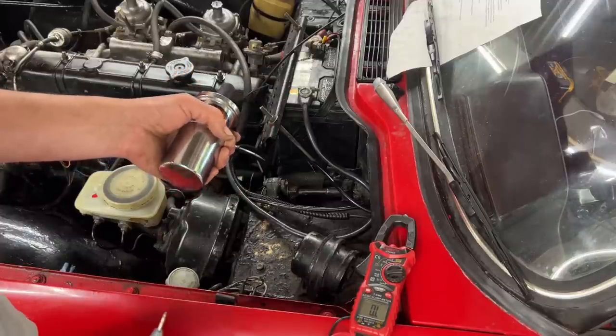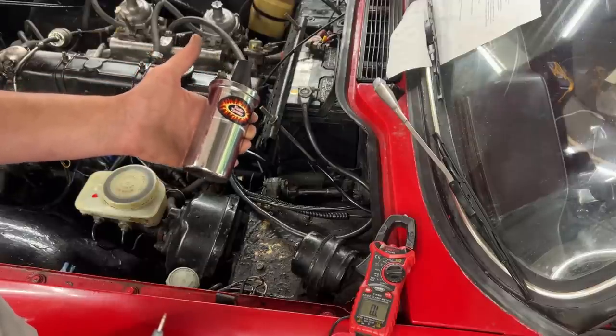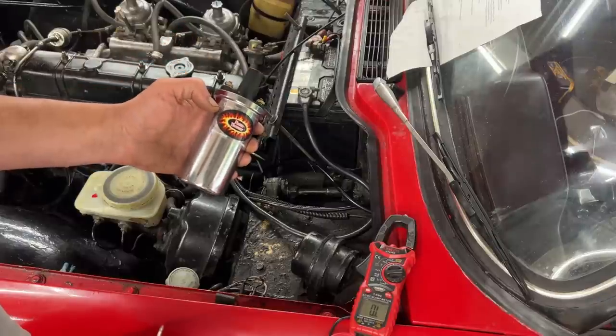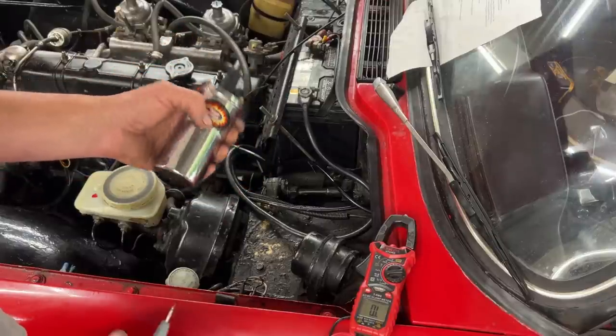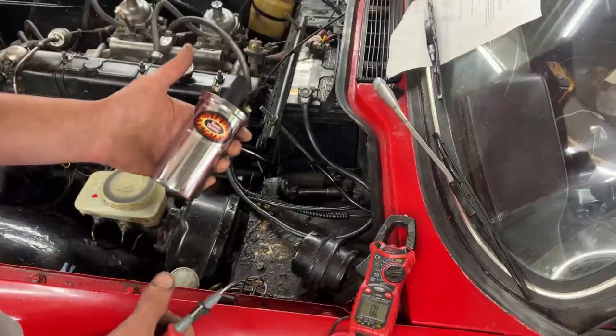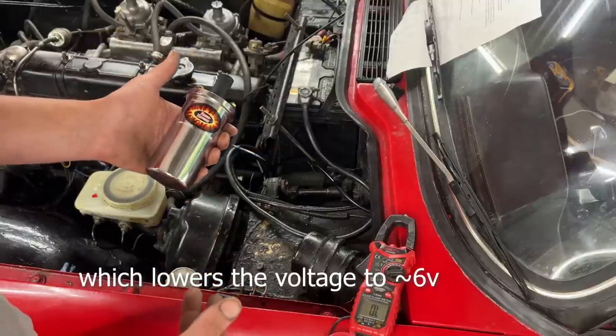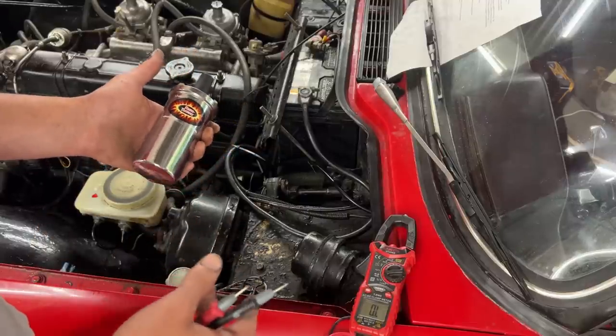So for the old cars, we have a 3-ohm coil, which is perfect for a 12-volt system. For later cars, they started using a 1.5 ohm coil, which runs through a resistor wire, which adds the missing 1.5 ohm. So it's basically again 3 ohm between the coil and the resistor wire, and that's how the car runs.